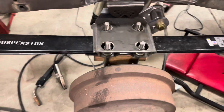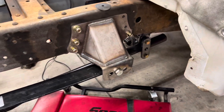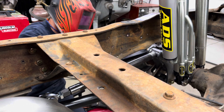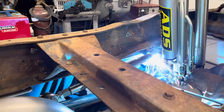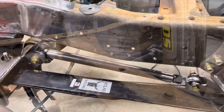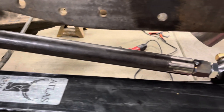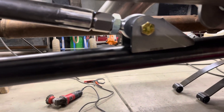I've got to run it wild because the axle moves back as it goes to bump — it's all the way at bump right now. I want to set that shackle angle at 90 degrees and vertical at ride height, not at bump. We got the top bar tacked in place — same thing, little chop saw notch, cleaned up and tacked right there. I'm not going to weld the mount on until I get the end length and angle figured out because it might move around a little bit.